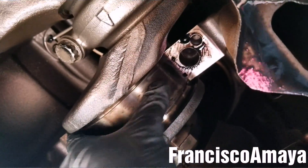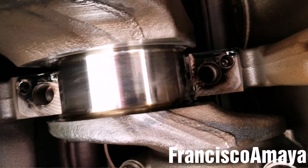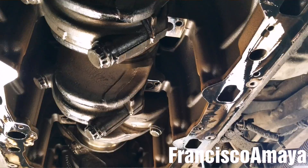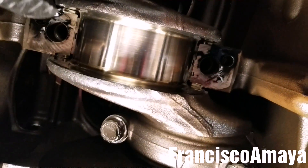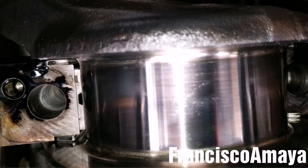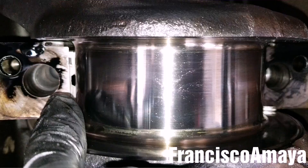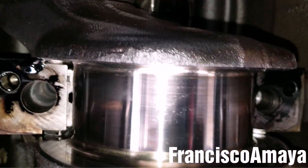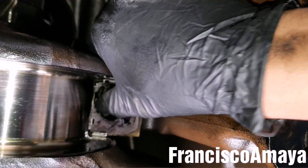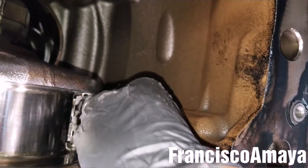That's the way you get out the top bearing of the crankshaft. Now I'm gonna repeat the same process with all the other bearings — four bearings in this case — the same way I just removed this one. After removing all of them, we get to number six, where the thrust bearings are. You can see there are two, one on each side. The way to remove the regular bearing here is the same as the others — just push it and pull it little by little. These thrust bearing ones are even easier: just push and grab with the other hand.